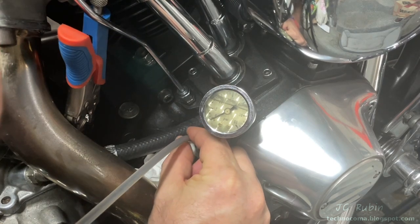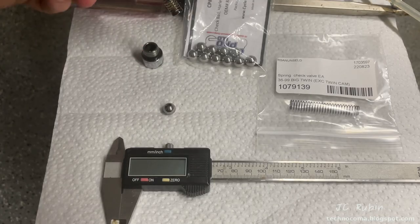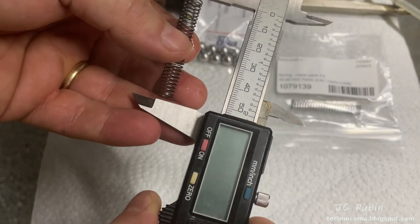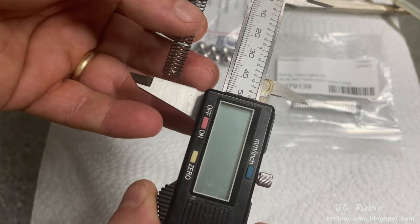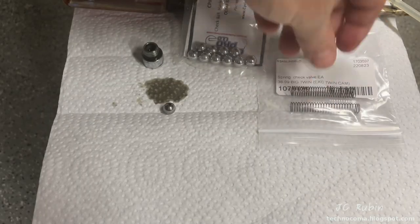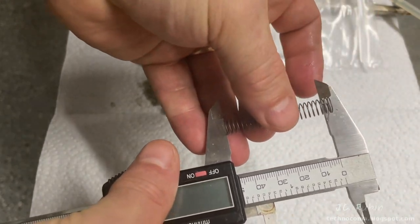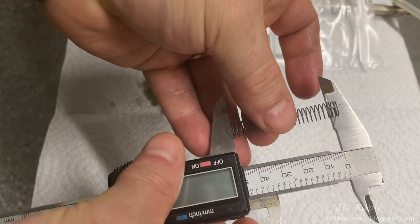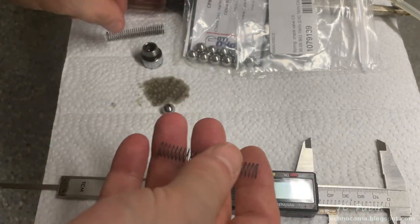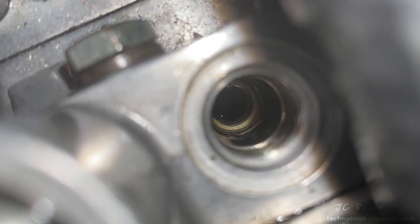One more pass with the silicon hose to get the oil level below the check ball level. I let the oil drain out of the old spring while getting calipers ready to measure it — more complicated than I thought, since you can't exert any force on the spring. I managed to get an approximation, but honestly you can just put them up against each other: the size comparison is substantial. This is OEM out of the bag, untouched, and it's much stronger than the one that's been in the bike for 40 years — a definite improvement.